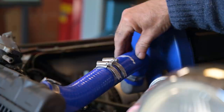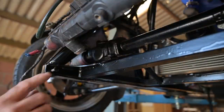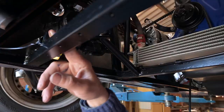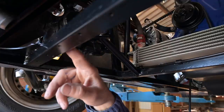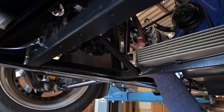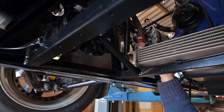That's the first connection done and I think it looks quite all right. Now the bottom hose is a completely different story. To run it, I need to start at the radiator, then make a bend, try to get in between the steering housing and the chassis or over it, then get over the oil cooler, go all the way to the back, and return back to the water pump. That's a lot of bends.